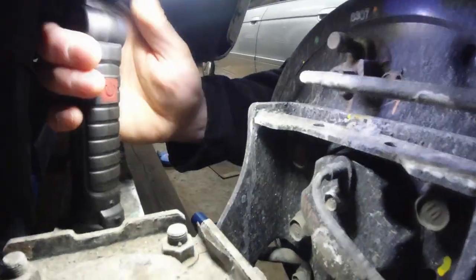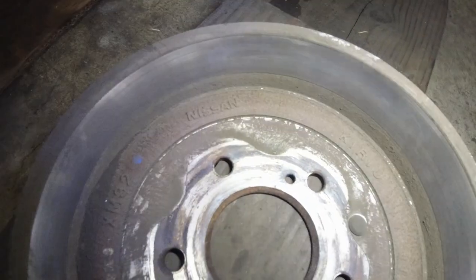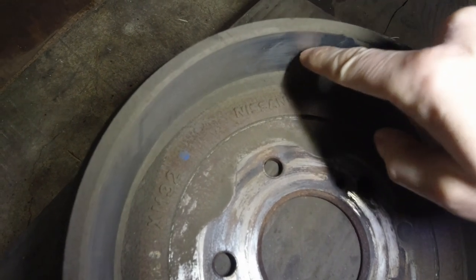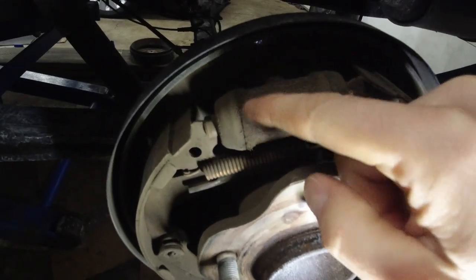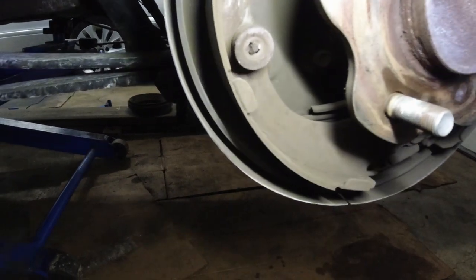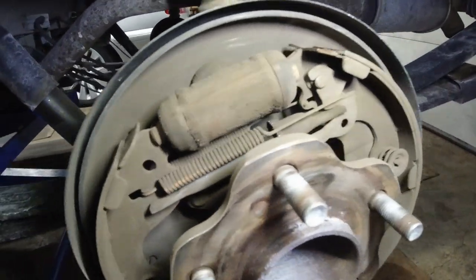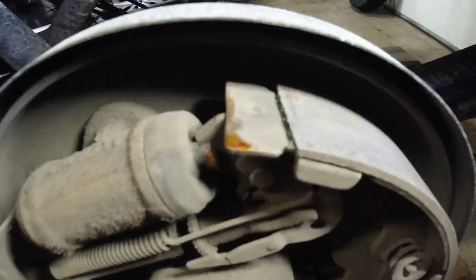What about the seepage they're talking about? That's just dust. Is there any seepage from the brake line? Nope, dry. Left side, driver's side drum — same story, I think this one is even better. Doesn't catch my fingernail at all. Looking for seepage again — just dust. All dry. Shields are worn, you can tell especially over here, but it is dry. The brake line is dry also.